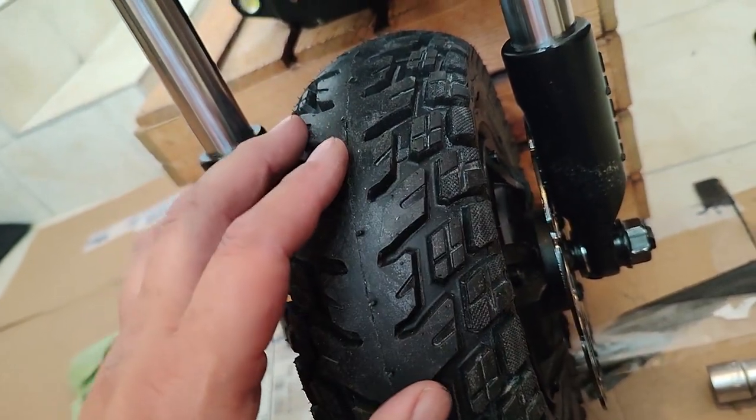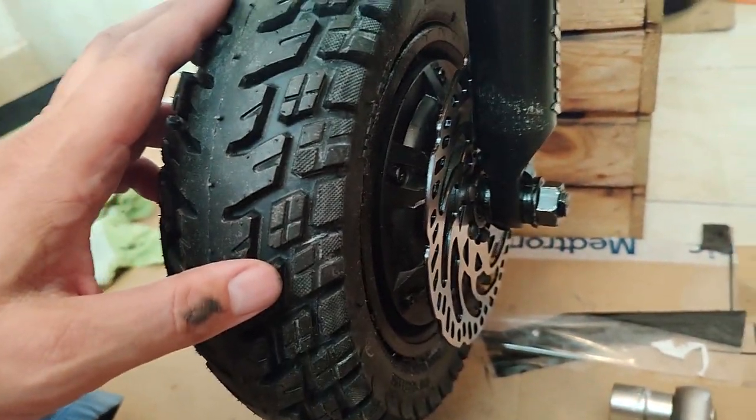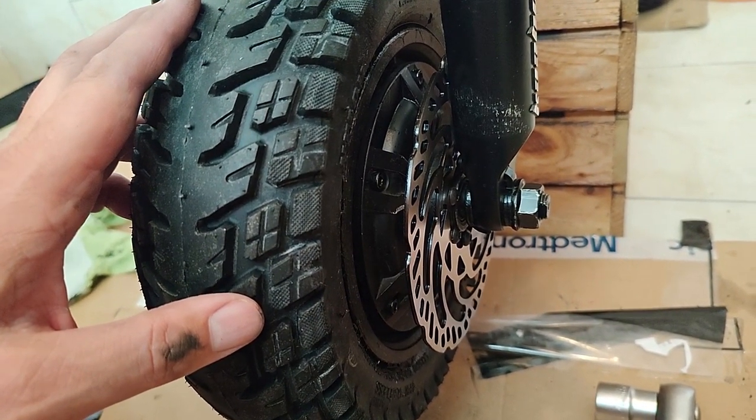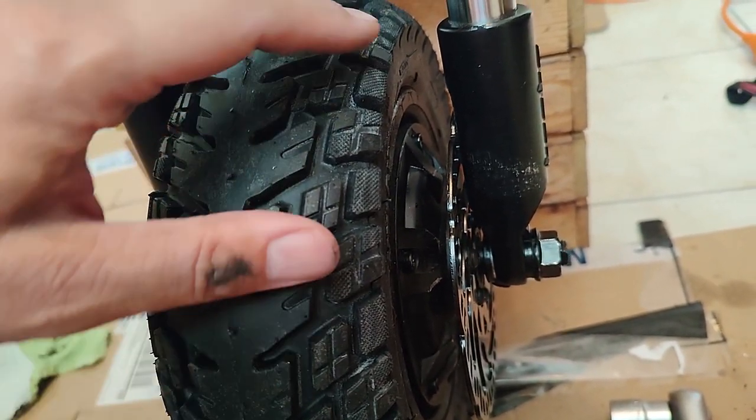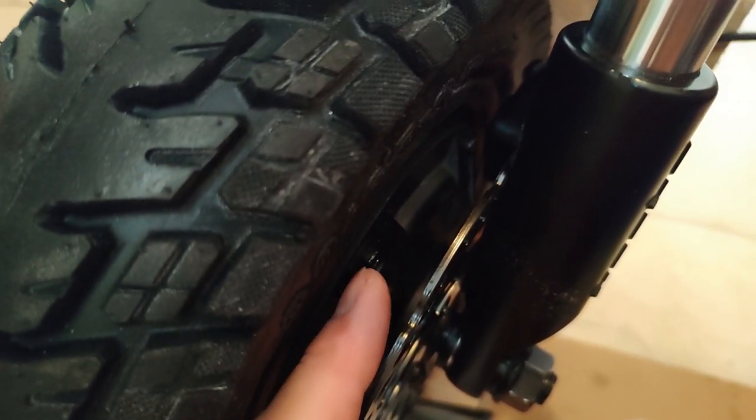But you do have to grind a bit off the Kaabo factory caliper mount that mounts to the fork, because it's a little too fat. It was touching the rotor, and I actually ground a little bit off the top part of the mount where the caliper mounts on. So you can see here in the clips about grinding.